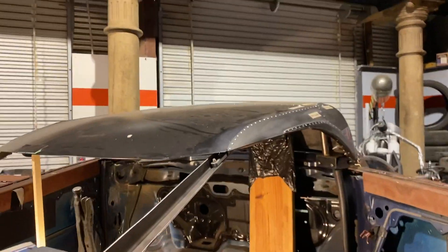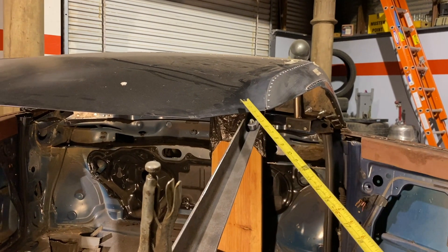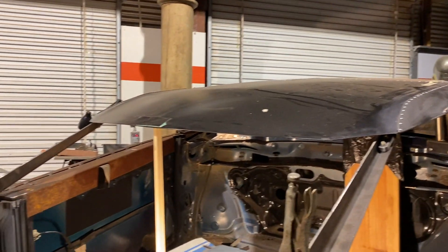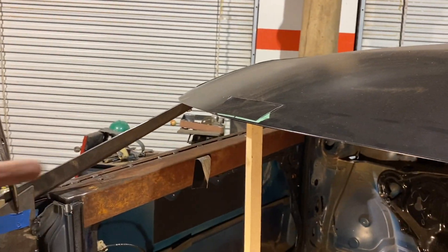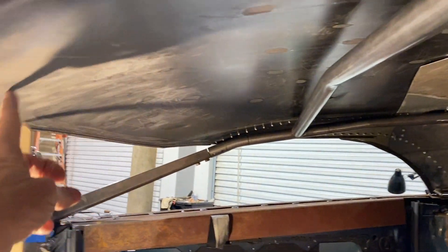One of the next steps is we're going to take some half-inch tubing and build the top of this windshield to come up and over, up inside here. The windshield is going to be up off the body — every bug on the planet is going to come right in there. We need some separation. So when we do this tube that comes up and over, we're also going to have to do a little bridge support across here to seal off the bugs and wind and everything. We'll do some kind of stiffener.